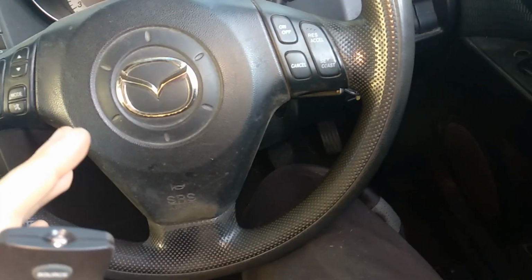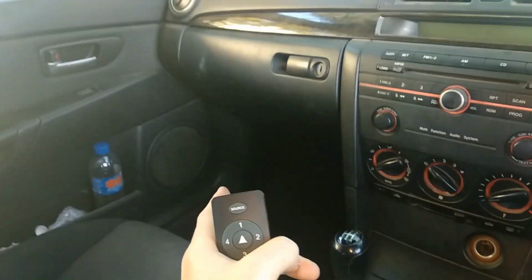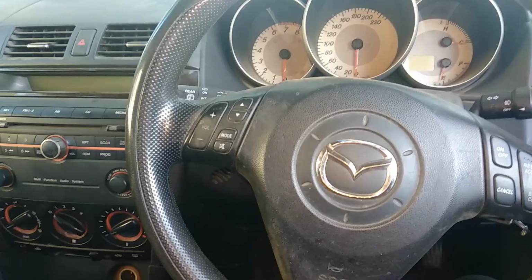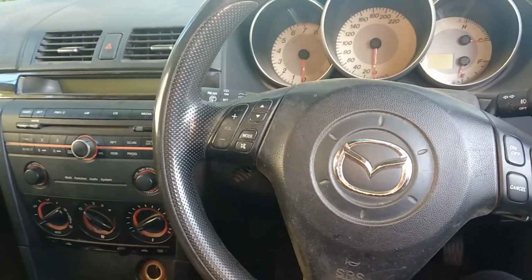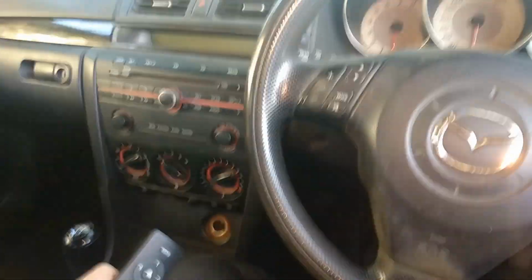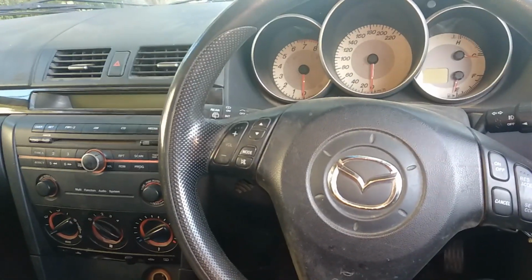And also I think, I'm trying to remember, it's 9 millisecond delay on that door, 7 millisecond delay on this door, and then by the time the bass arrives from the back, it's all in sync. So yeah, that sounds really good. When the sub's at about a quarter volume, the system sounds incredibly blended. There's no way you can tell the sub's on at all. Like the 70 hertz crossover too, it's really hard to tell unless there is a 70 hertz tone. You can't really hear anything specifically coming from the back, other than when you crank it, you can hear some rattles coming from the back.